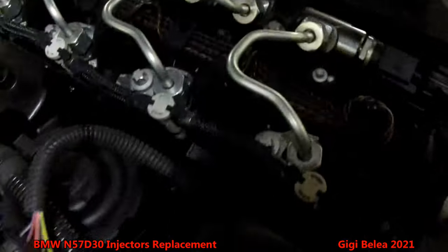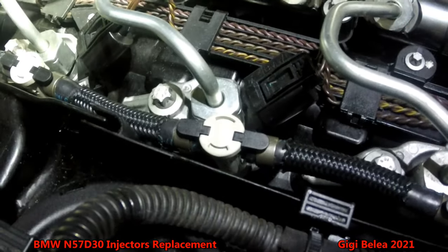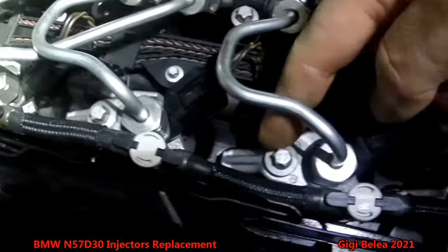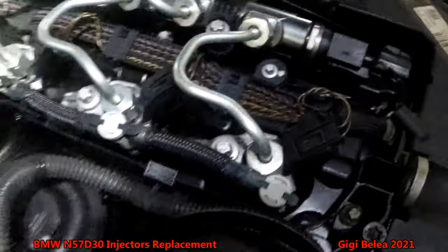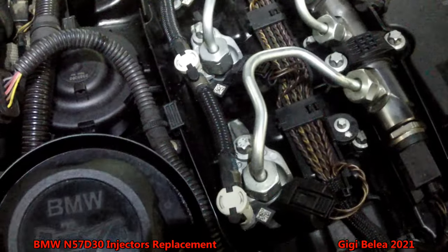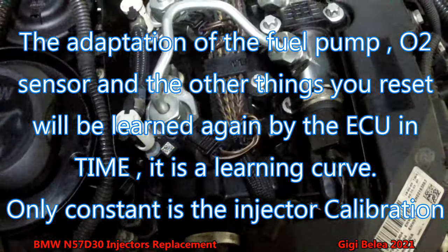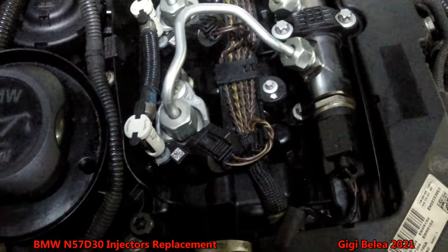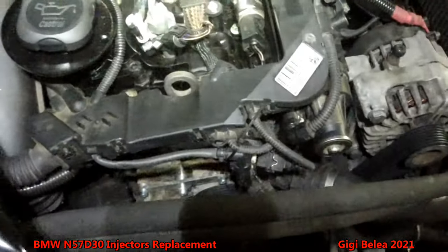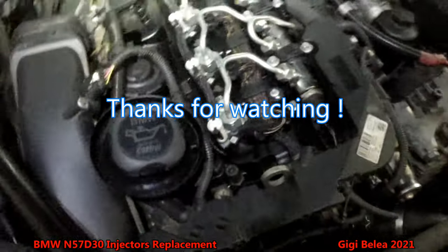It's not so complicated. You can see the E-screws and the clamps — one, two, three, four, five, six — you take them out, put them back in. The only thing you need is a tester to code the injectors, bleed the fuel system, reset the fuel pump, and reset the ECU adaptation — which BMW recommends when changing injectors. That was it for today. If you have any questions leave a comment below and I'll try to answer everybody. Thanks guys, bye.